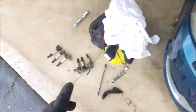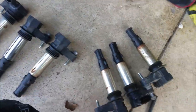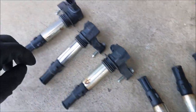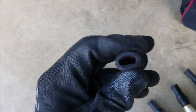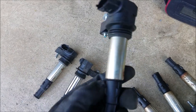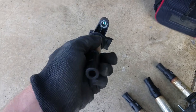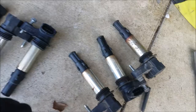I ended up pulling the coil packs. This is the front three cylinders, and these are the coil packs for the rear three. I believe these coils are a mixture of Bosch and Delphi brand, but they're definitely worn out. The rubber is all dried and cracked, real squishy, and there's a lot of crud on the side. It seems like the valve cover gaskets have been leaking, getting on the sides of these and working their way down. These are definitely past their prime.